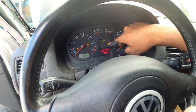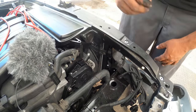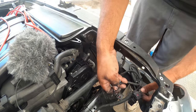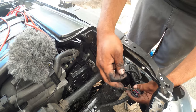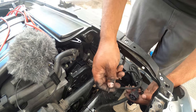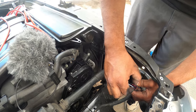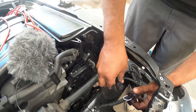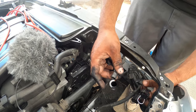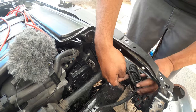Now let's turn off this light in the right-hand corner. This light's a little on the trickier side because it's home to a couple of other sensors here. There are two of them: there's a big chunky one and there's a little thin 90-degree one. There's no harm, no foul if you jump either of these two wires. The other ones are the headlight, your turn signal, and your hood sensor — so leave those alone. I think this is the hood latch sensor.